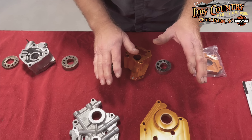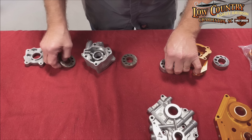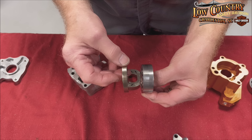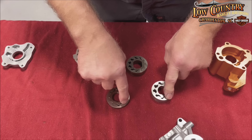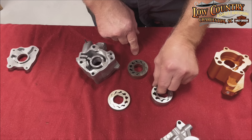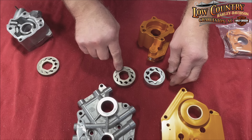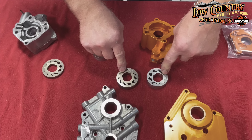I've got a 2017, 2018, 2019 oil pump right here — look at the difference they've come. From the 2017 to the high performance oil pump feed, you can see the different gear pattern versus the multiple lobes on the old style. You've got a different pattern for getting more volume through the bike. And going to the return, same thing — more lobes on the old style versus fewer to get more volume and more oil flow through it.